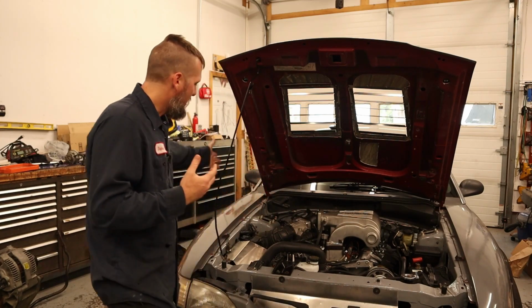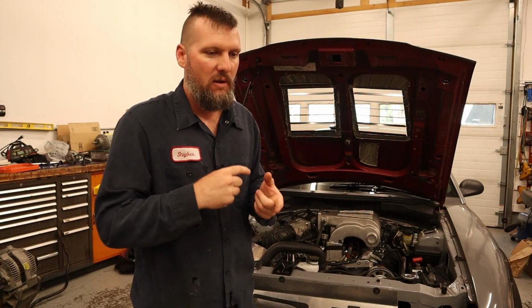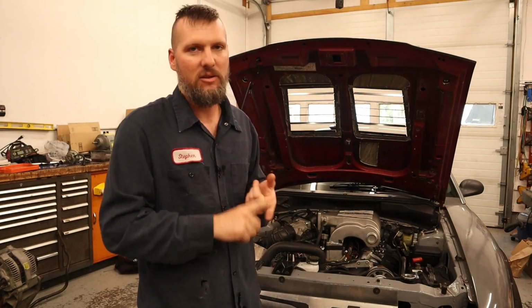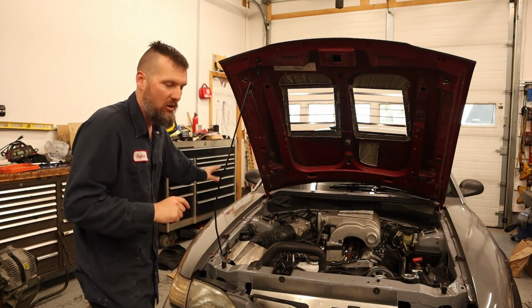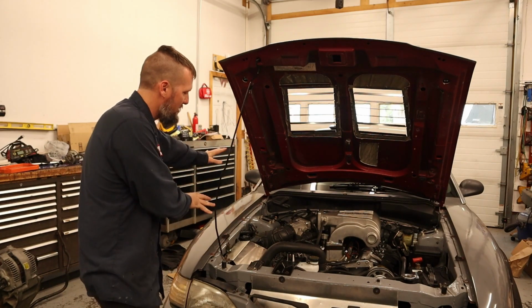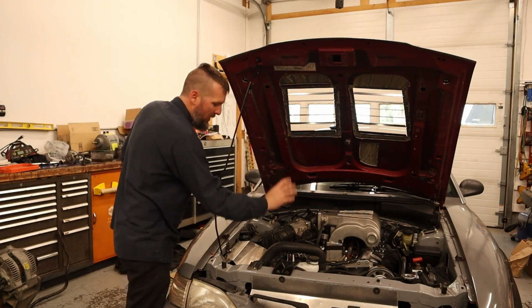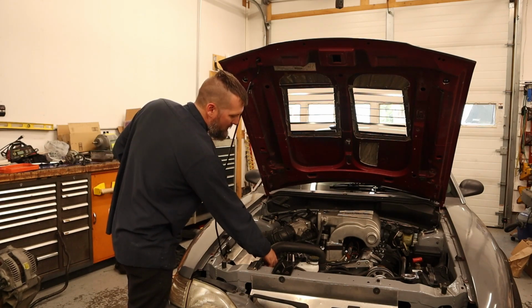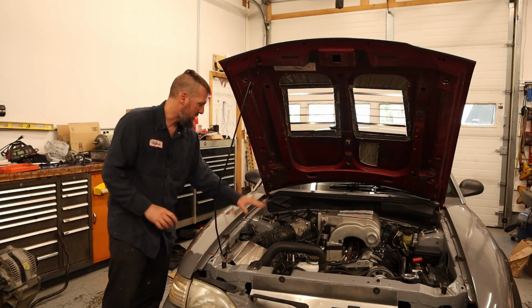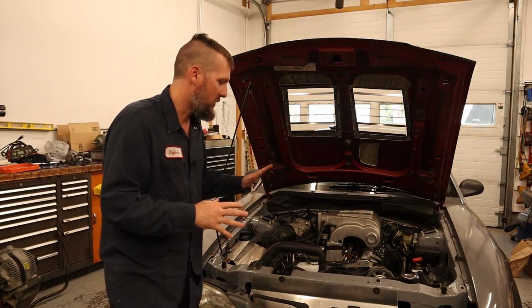Then for the fender harness, I used the V6 one, basically because it already had the EEC-V harness on it, so I didn't have to hack in some other harness because you can't get those pins. And then I would have had to modify any other harness, but that one I know fits in this car. It has all the right lengths from the ECU all the way up to the fan control or the constant control relay module up here and the mass airflow. Everything works and it's the right length. So that was the main reason.